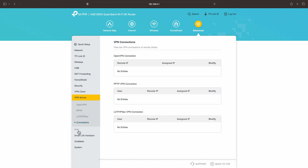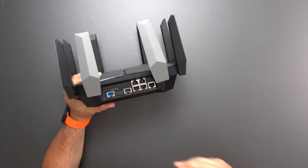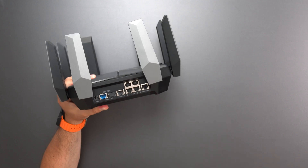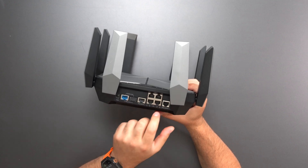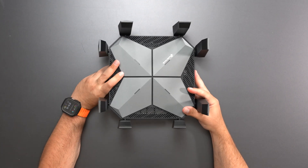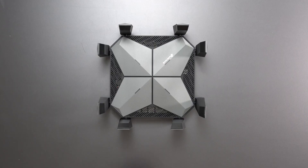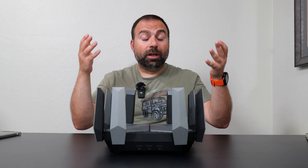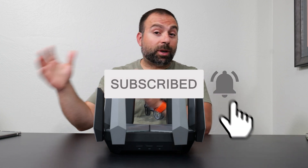In summary, this is a fantastic router for anyone with internet speeds of up to 10 gigabits. The fact that you have two 10 gig ports means if you have a 10 gig unmanaged switch, you can run internet to one port and then go to your switch, giving you 10 gig throughout. You also have a 2.5GB port and four other gigabit ports — generally a lot of usable ports. Very good interface, very good speeds, very good range, and it sells for a very good price considering this is a quad-band router with a crazy fast speed rating. If you guys enjoyed this video, smash that subscribe button — I have a lot more router and mesh Wi-Fi videos coming up.